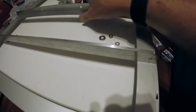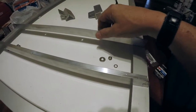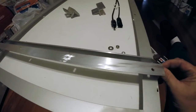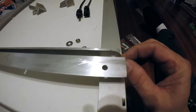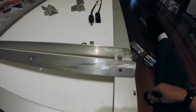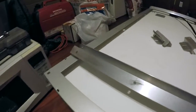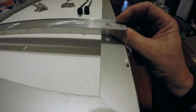Mounted to the camper will be the other half of the system. This piece has four holes along one edge that gets screwed to the roof of the camper, and then two holes - one on each end - that match up with the panel-side piece. The reason I've rounded off one edge is so these can function as tilt mounts. I can undo one bolt and the panel will pivot on the other bolt, tilting in either direction - I just need to pull one bolt on each mount to make that happen.